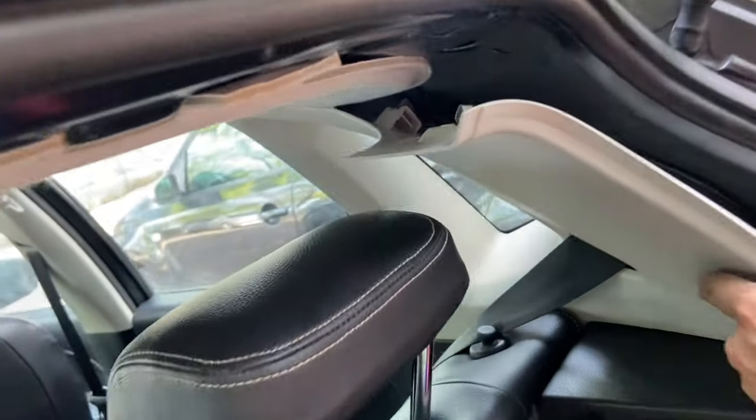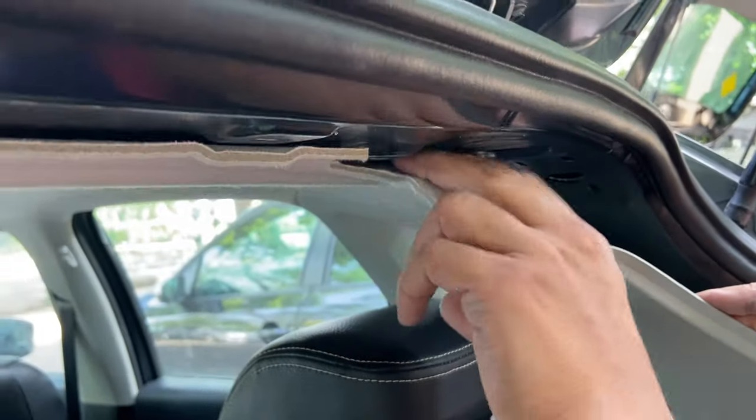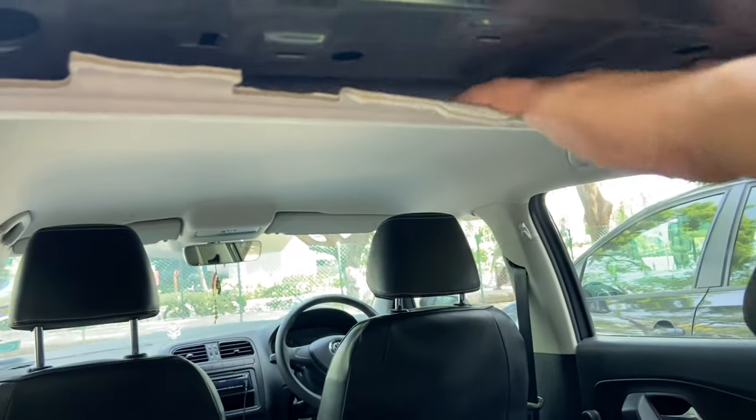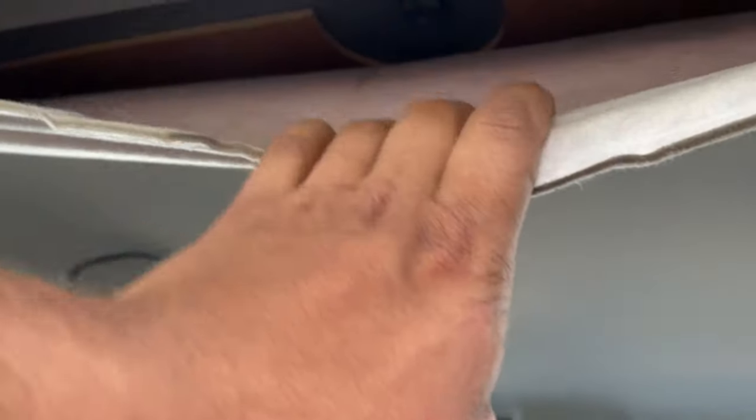This is the roof area that goes to the ceiling. You can see the antenna right there. And this is the FAKRA connector which we have to remove. Don't bend the liner here, because you can see that crease developing if you bend it too much — if you hold it for too long the crease would stay permanent, so be careful.